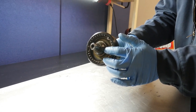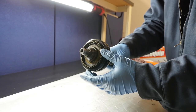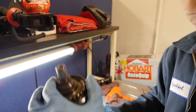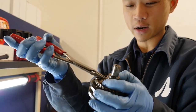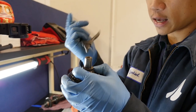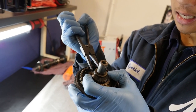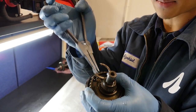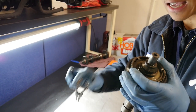This snap ring is really tough to get off, so this is where these pliers come in handy. I'll shift this into third just to give me some room. I'm checking which pliers will work better — we'll try the black ones. That went a lot easier than it probably will for you. Sometimes these get jammed and rusted; if you have rust penetrant I'd let it soak in there, otherwise you're going to fight them.